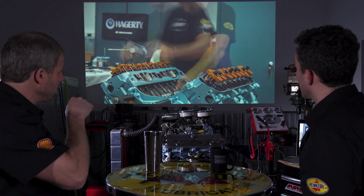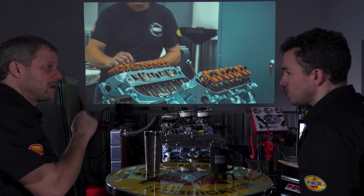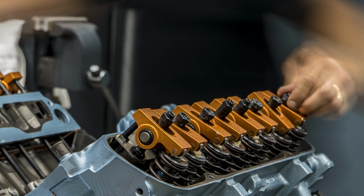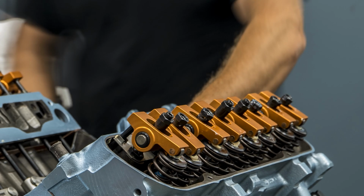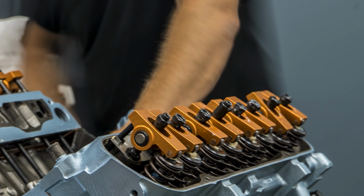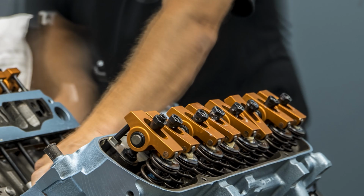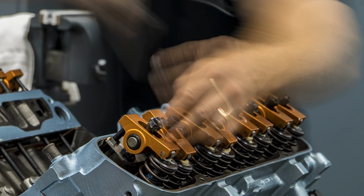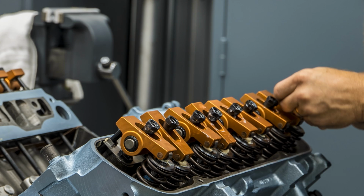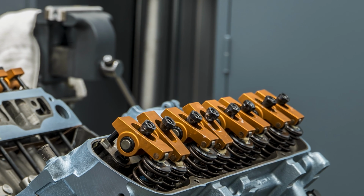Now this is a 0 lash because it's hydraulic, but you actually rotate it. So you bring it to 0 lash, and then because it's hydraulic, depending on cam manufacturer and lifters, you give it a quarter to a half a turn, which basically preloads that lifter by roughly 20 to 40 thousandths, depending on thread pitch. That takes up that slop, and they don't clatter.